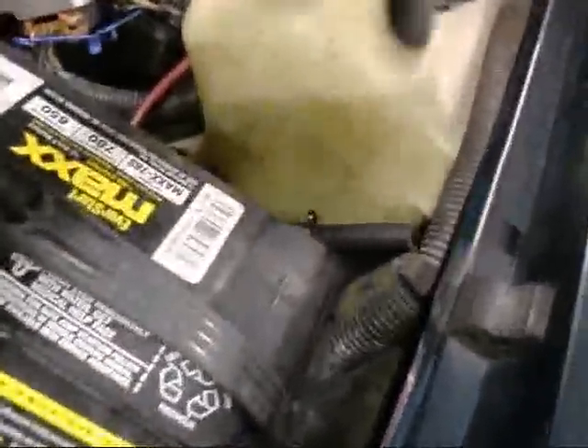All the 4.3s and 6.5s have this setup — the 4.3s have the oil filter over here, the 6.5s have the oil filter right there. I have my inner fender shields to put on as well. I took off the crew cab pieces — parts missing — my shields stop salt from splashing into the exhaust manifolds. The new Chevy trucks from 2000 and up don't have any shields at all — stupid, all that crap gets into the engine from the wheels.